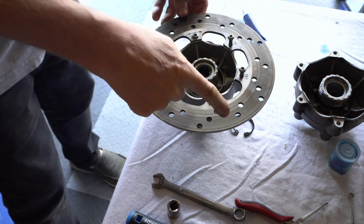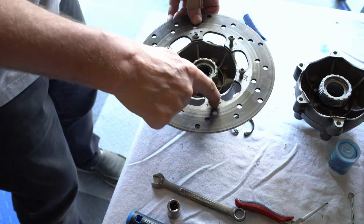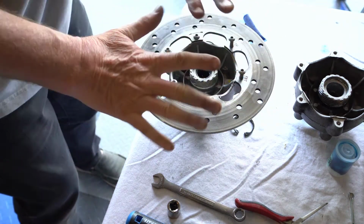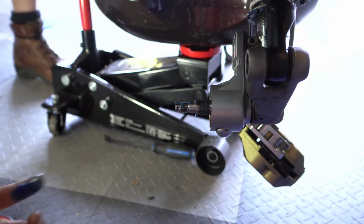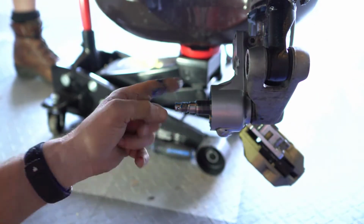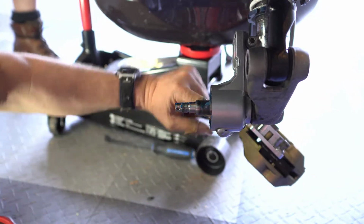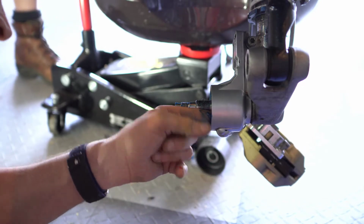Okay, so when you're tightening these, it's important that you don't go around 1, 2, 3, 4. You want to do 1, then 2, then 3, then 4, then 5, then 6, so that you don't warp it and it all tightens evenly, and we're going to do the same when we torque it. And I decided that I'm just going to put some extra grease in here because we had cleaned it all off before, so I'm greasing this whole thing and getting as much grease in there as I can. It's all bearing grease, I want to get it everywhere.